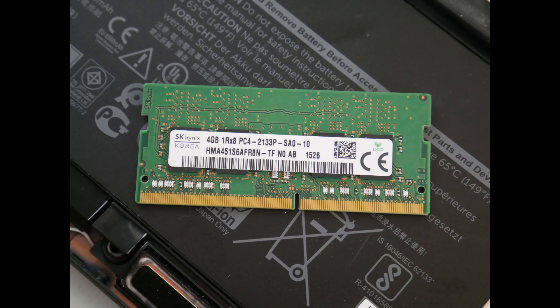This is what your RAM stick looks like. The code you need is PC4-2133 to order another stick of RAM, or it would be a code similar to this. If you only have one RAM stick, you may need to buy a new one and try swapping it out if you don't have the option of taking one out. Don't forget you can always upgrade to more gigabytes of RAM, which is never a bad thing.